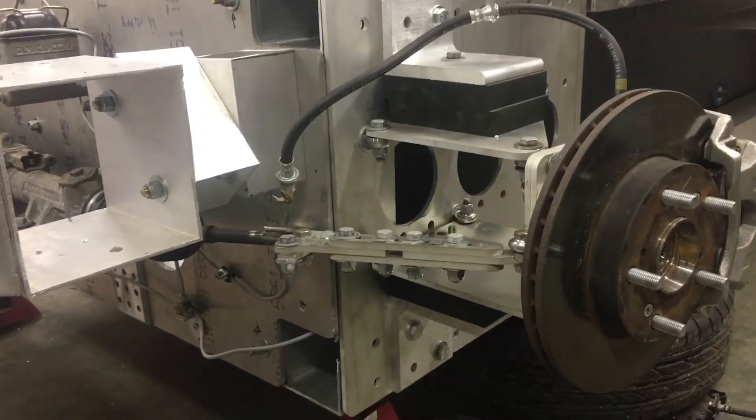All of these are identical M12s as opposed to the old ones that had different sizing — instead of 19 millimeter all the way through, the last ones had 19 and 17 millimeters. So we went to just 19s, so that when we want to swap this on the track it would be quick and easy, saving time by not having to use two sets of tools. That is a lot of fancy brake line work, so we will have to be very careful not to kink any of it, otherwise we'll have to be rewiring new brake lines.